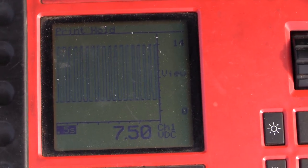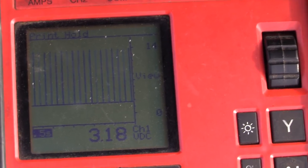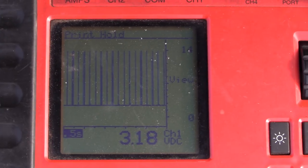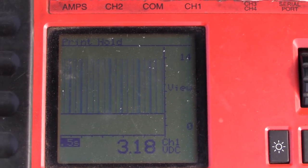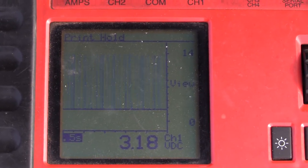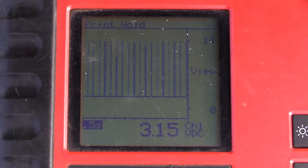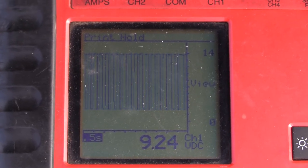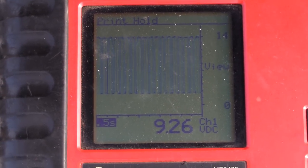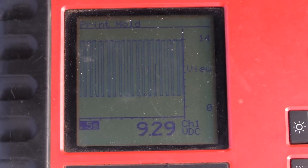Watch — our average voltage is dropping because our pulse width is changing. Just using my old-school Vantage here; it doesn't have a faster screen time, but you can look at the signals and our on-time is a lot less. Now putting the blower on high, then on low — as he's moving through the settings, you can see the pulse width has changed, giving us a different average voltage.